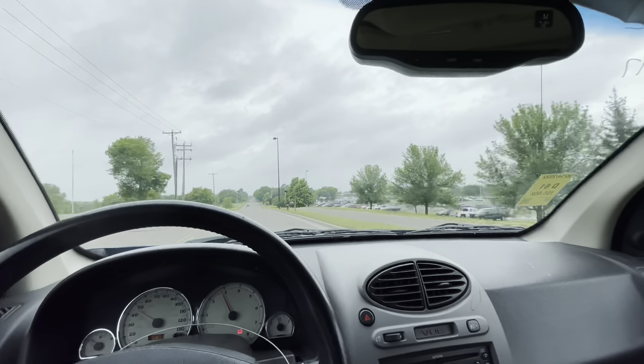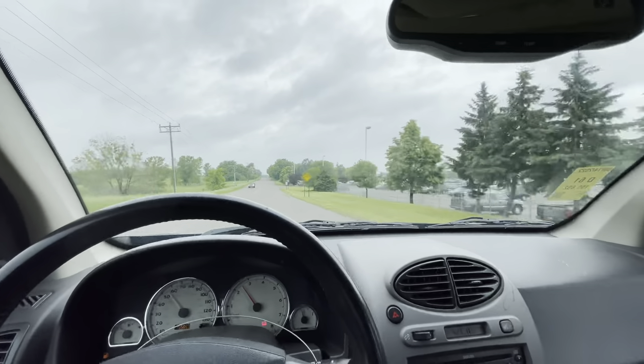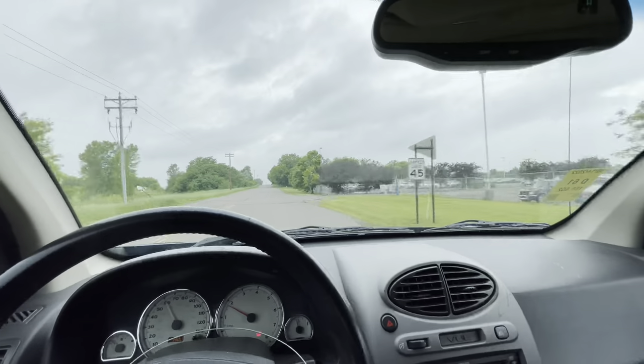Shifting the way it should. Up to about 50 miles per hour — okay, up to 60. I definitely need those struts. Suspension is okay, brakes are good, but that rear one is terrible — I know y'all can hear that. I'm gonna get this joint back and have them get some gas in it. I'm also gonna check that trailing arm because it kind of sounds like what happened to me on that Chevy Equinox — it wasn't the strut, it was actually the frame. I don't want that to happen again.